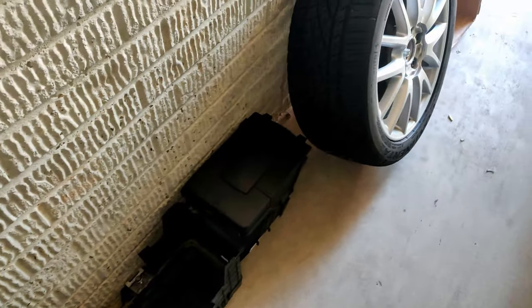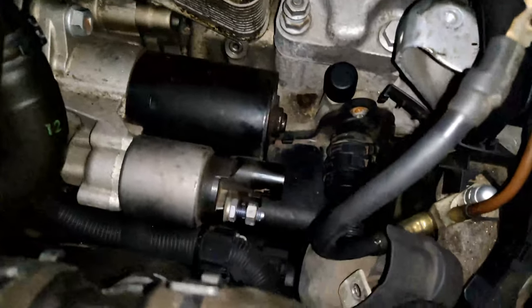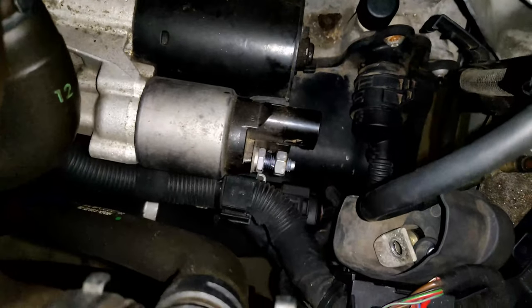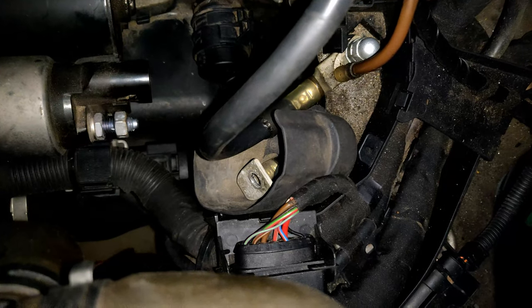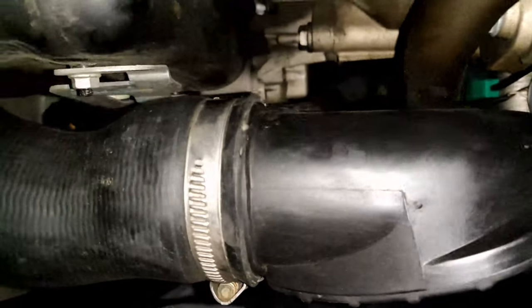Here's the battery and its case — very easy parts to remove. It's just a single 13mm bolt that allows the battery to come out, then three 10mm bolts and it comes out diagonally upward. I've also removed the belly pan, the fender liner on the driver's side, and the starter — which was simpler than expected. It's just a 14mm hex bolt and one of those typical VW pinch electrical connectors that pops right off, holding a ground wire and a protective cover for the positive terminal.